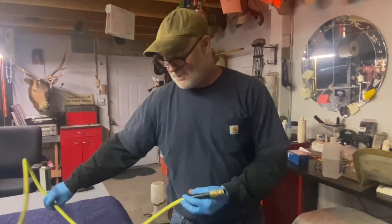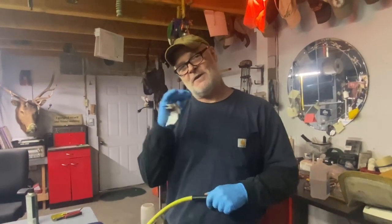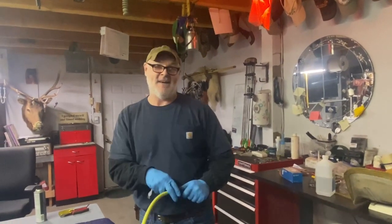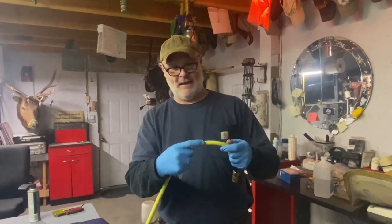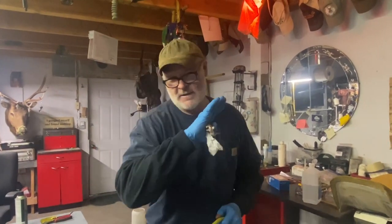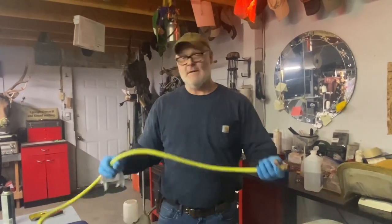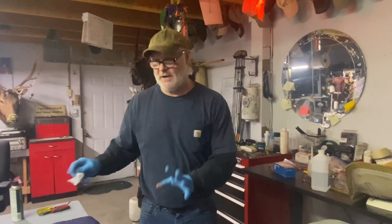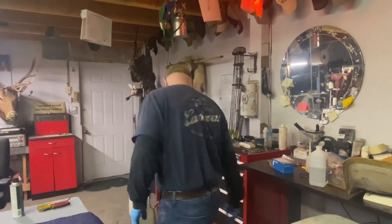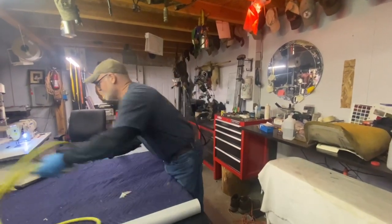And you look back and your hose drug across the top of that seat. If you put too many chemicals on vinyls, you'll take off the finish. At a distance, even though you got that skid mark or that black dirt stain out, you'll see a slight variation of color. So you've removed some of the patina, if you will, on the vinyls. Just a little trick, so always clean your stuff, have it all ready. We're using black, but even black can take a mar off of a dirty hose. Okay, so this is how you do it.